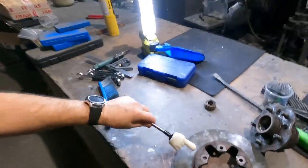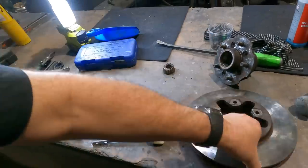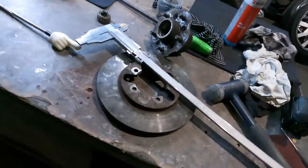And here's the problem: they don't make them anymore. It's quite a small diameter and it's vented. I've found stuff with the same sort of diameter - non-vented ones - but this is a heavy car, it's two tons, so we need a vented disc. We need as good brakes on it as possible. I wonder if it's common to a Chevy or something. What I'm going to do - the whole point of this exercise here today - is to measure everything up, get some dimensions, and see if we can find somebody either with the right disc rotor or something that we can machine and adapt onto it.